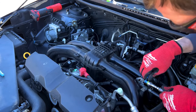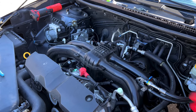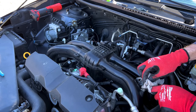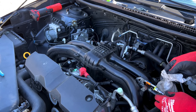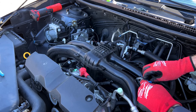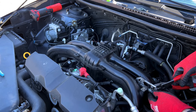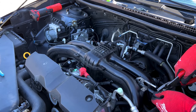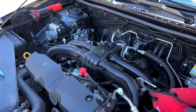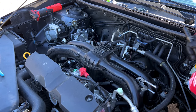Just work your tool in like so, push the fuel line forward until the tool slides in, you can pull it back again. With pressurized fuel, wrap around it to catch the spray and pull it off like so, and set it off to the side. We have our disconnect tool — go ahead and pull the clamp and our hose off and pop that off to the side as well.